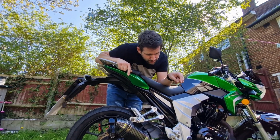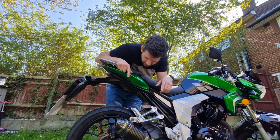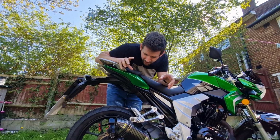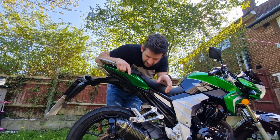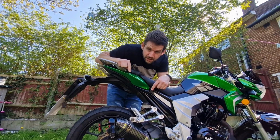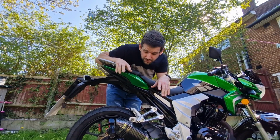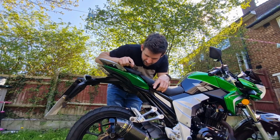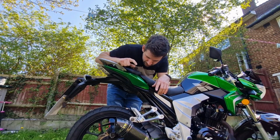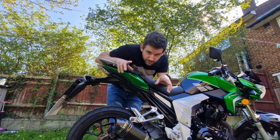So now we've done the master. It's got to be the caliper sticking. I have found a rebuild kit for it, if it fits, but it's going to take like 2 weeks to arrive. Either way, I'm going to pull it apart today, just give the caliper a clean up, pop the piston out, see if that helps. So I've got to take the wheel off, pop the brakes apart, and we'll see how that goes.